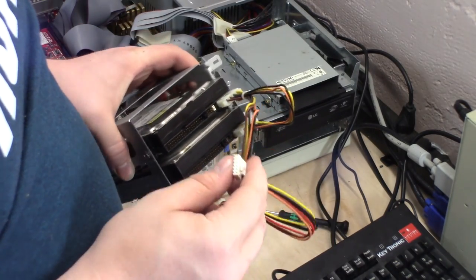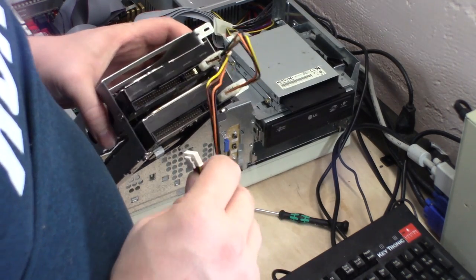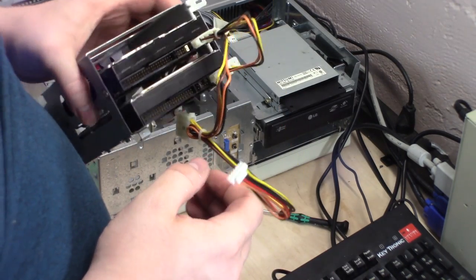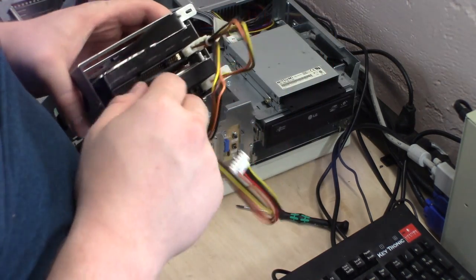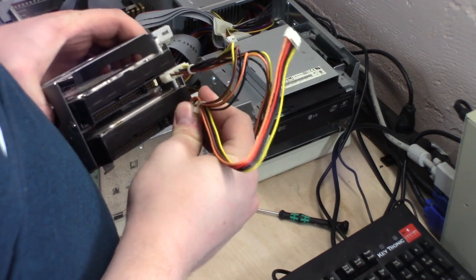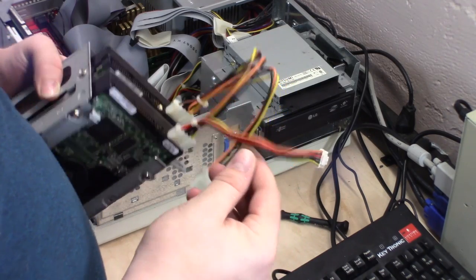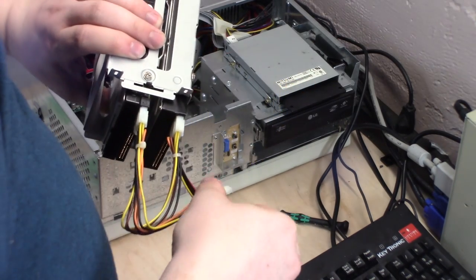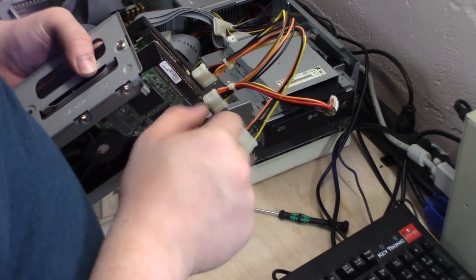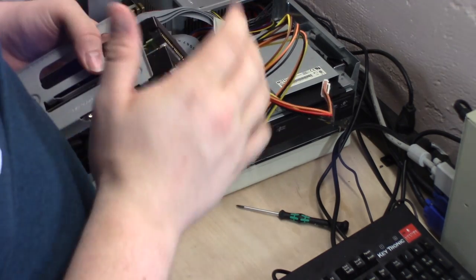It's worth pointing out this one doesn't have enough conductors to interrupt power to each hard drive individually, so this one can't be using that approach — it's gotta be using the approach of turning off the data lines themselves. These are labeled HDD1 through 3. Actually no — the 12 volt is always supplied, it's the 5 volt they deprive it of. Brown, red, orange — that's enough conductors. So they're switching power as well. That's good — it means your hard drive isn't sitting there burning up power when there's nothing going on.